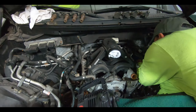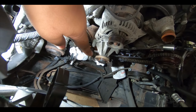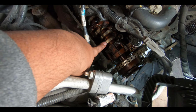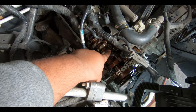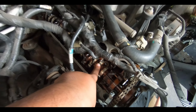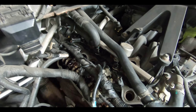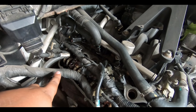Guys, so the next thing we're doing, before we take everything apart, is that we need to relieve the pressure on the cam before we remove it. So if you see the little dowel pin right there on the crank, that has to point to 12, and the lobes on the passenger side here have to point to 11 o'clock. And then once these are at 11 o'clock, you're going to put your tool and remove the roller rockers, the rockers on the first, I'm sorry, in the middle of the first cylinder here, and then the very back lobe, and the one closest to the cap here is the other one you have to remove. So it's 3 on each side, and the driver's side is the reverse of this side. So instead of 1 on the front, you're taking the 2 front and back, and then on the back it's the middle one of the last cylinder.